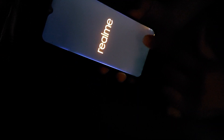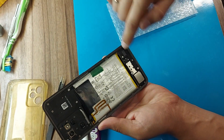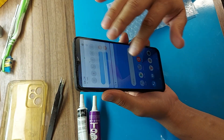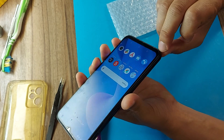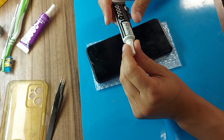And I see a blue reflection on the side of the screen — this indicates that it is squeezed. After turning it on, let's check how the touch screen works. I put the cover back in place and tightened the screws. The touch screen is fully functional. Only there are small dots on the display — this is due to the uneven body. It also needs to be glued.